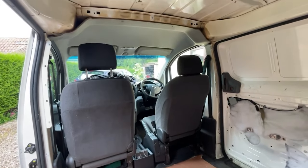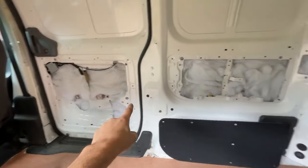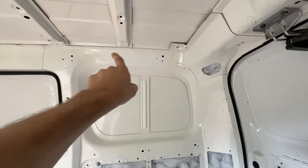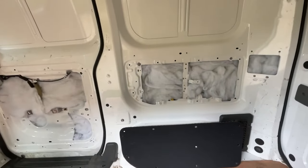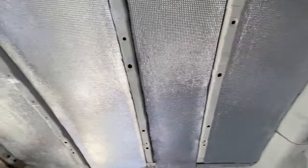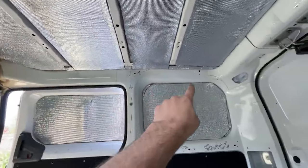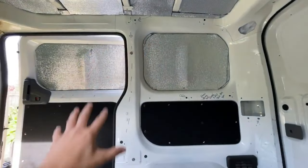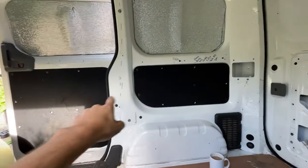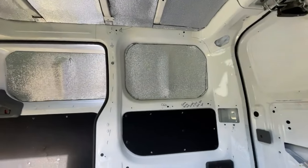The bulkhead is now all gone and it's starting to feel a bit bigger in here. I've moved on to the insulation — I've started to fill the cavities inside here and up there, gone as far as I can, just making sure I don't leave any gaps. The roof is ready for the carpet. I still need to do the side bits and walls, but this side is fully ready. The panels are back on and all the insulation is in behind them, so the next thing I'm going to have a go at is doing all this wall on this side.